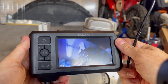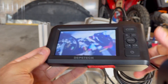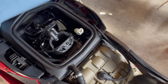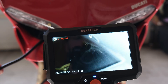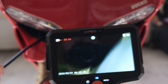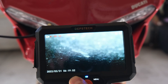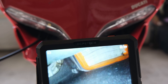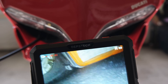This is the kind of thing I wish you could take with you when you're going to buy a used bike — if the seller will let you sit there with the borescope and check it out. One other cool thing with the borescope is instead of having to pull the gas tank and all that off to get to the air filter, you can push it right through the nose of the bike. Oh there's the air filter — you can see some nastiness on that thing.